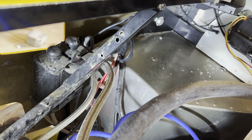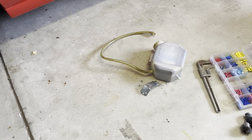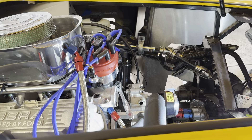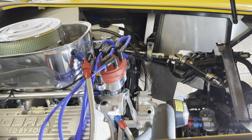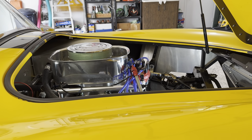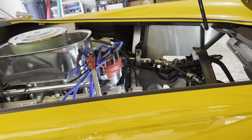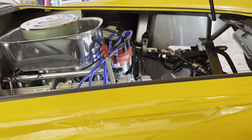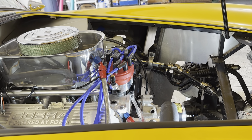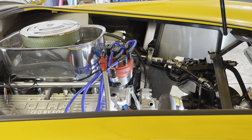Continuing to work on cleaning up and prepping. I removed the old coolant overflow can — it was on the passenger side tucked under the body — but with the new degas surge tank, the overflow is on the driver's side, so I'll get a different style bottle and tuck it over there. I went ahead and ordered some bolts: 7/16-14 by 1 inch for the coil bracket, along with a one-and-a-half-inch aluminum hose coupler and a Dayco OEM replacement lower hose for a Mustang. Should have them in a couple of days.